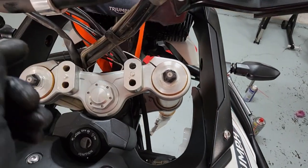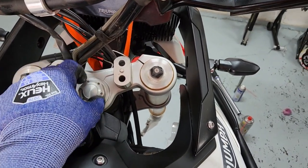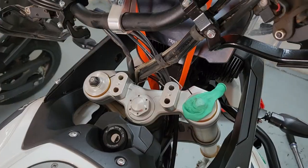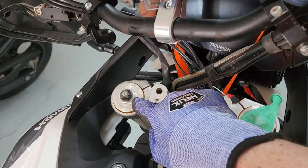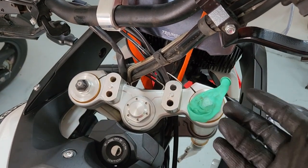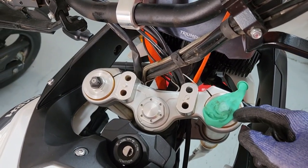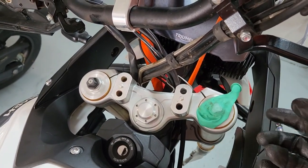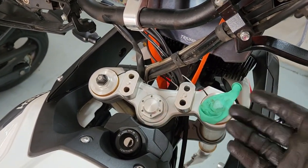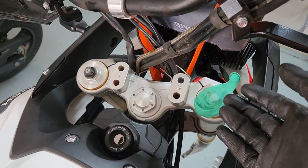While we're doing that, I'm going to mark this in the 12 o'clock position so hopefully the torque settings will suffice. Now, tape things up so you don't scratch anything. There are a couple of lines of thought here: either you loosen the caps before you take the forks off, or you take them off and hold them very firmly to open them. If you've got a vice, you can do it there. For lazy people, I say loosen them now — it's easier.